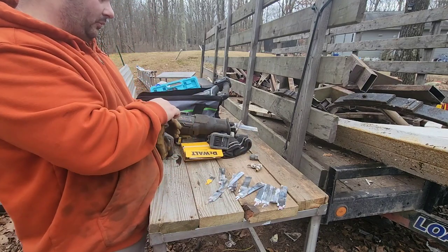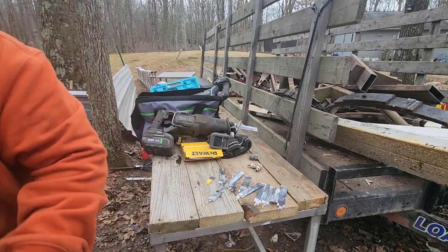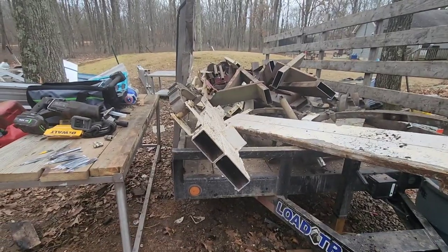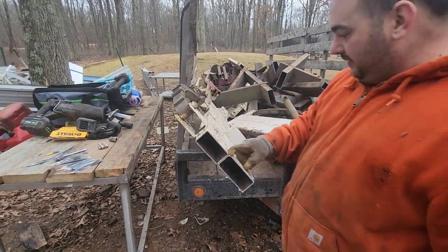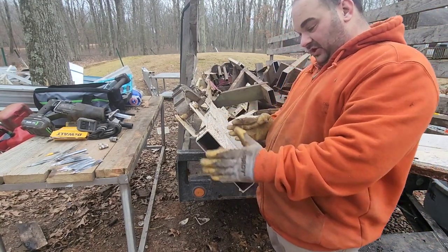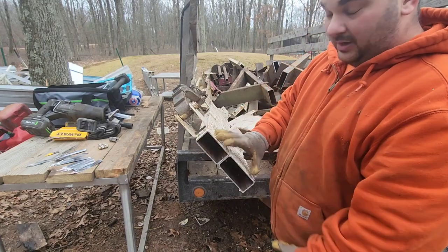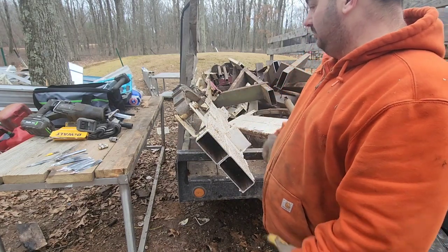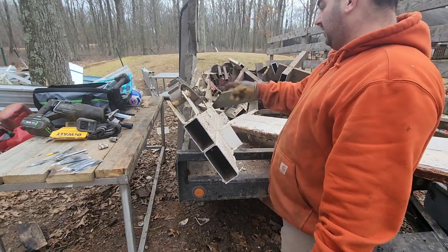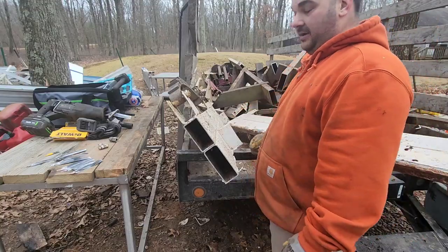Now the second frame, the white frame, I only went through three blades, even cutting the axle, because there it wasn't welded in the middle like that. And as you see, it was welded in spots, but I could see to miss it. It's welded here. Welded here, so I just went in between the welds, and you could see it was doubled, so it was double as thick, and I didn't even go through as many Sawzall blades. And these pieces are pretty heavy with the leaf springs, they're pretty stout. And the axle was bigger on this one, this is a heavier camper.